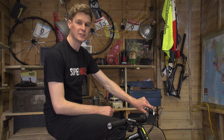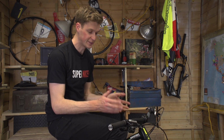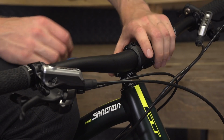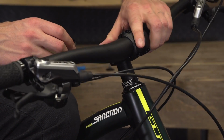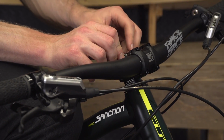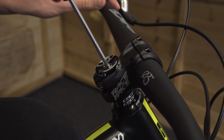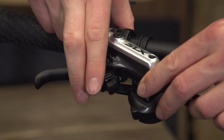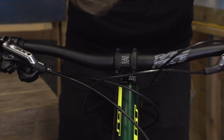One of the biggest things that really makes a bike good or bad is the cockpit setup. So the first thing that I'm going to do is set my bar height, and I'm just going to lift the stem off and set the spacers. Now I've actually done a video on this already, so check out the Mission Control series. The link will be in the description down below. And you just play around. I know what I like, and it takes a little bit of time for you to find out what you like. Other factors to consider when you're adjusting your cockpit are your brake lever angle, and also the distance you are from the grip and your bar roll.